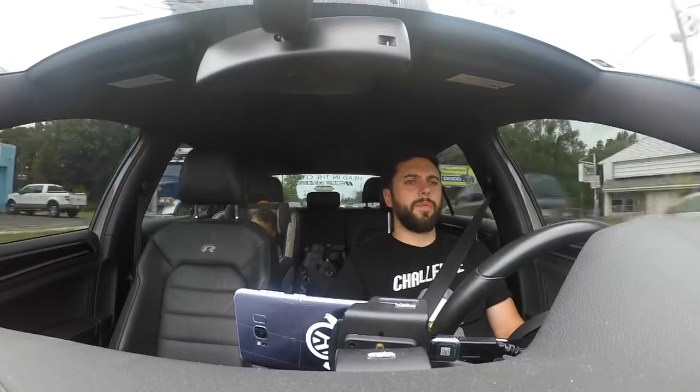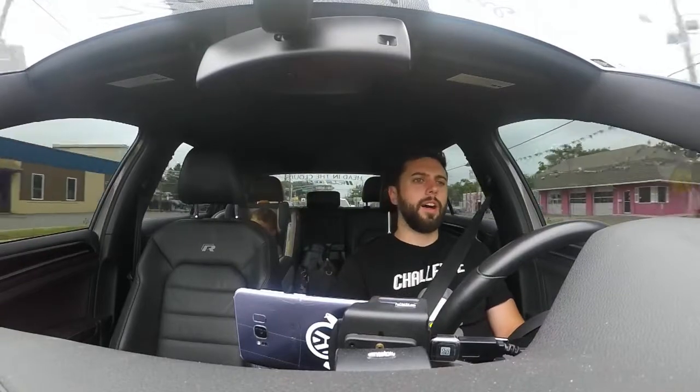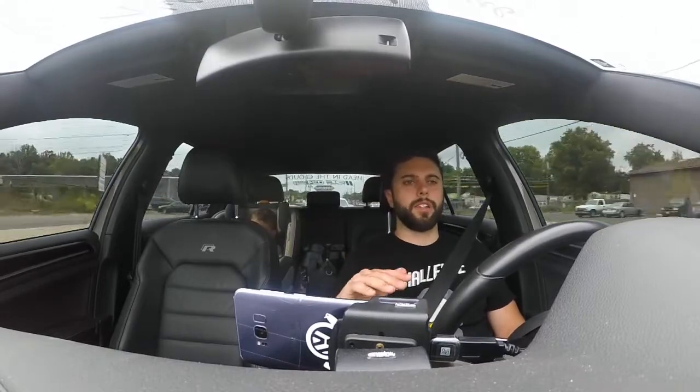Send in your logs to George and Burger. I imagine when you're starting to stack and running bigger turbos and utilizing the JB4 after the fact, you may come into situations where you need to change your fuel trims on the spot. So that's what that's for. But definitely if you plan on messing with that function, run a few logs, send them over to George, get a good baseline tune going, and then he'll determine if it's actually going to help or if it's even necessary to do that type of thing.